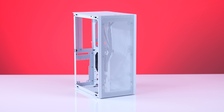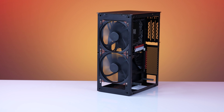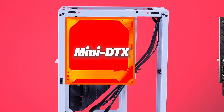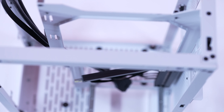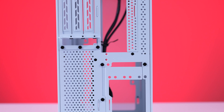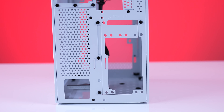Just be mindful of your tube and fan cable management. For fans only, you can fit two 120mm or two 140mm fans in the front. For the motherboard, you have two options: Mini ITX or Mini DTX, such as the ASUS Mini DTX ROG Crosshair. The motherboard tray functions as a divider, splitting the space between your motherboard and CPU side, with the GPU fitting on the back. The Meshlicious supports three-slot GPUs up to 332mm length and 155mm width, and four-slot GPUs up to 336mm length and 155mm width.